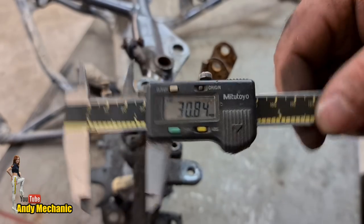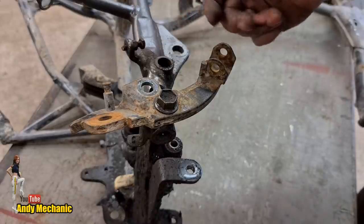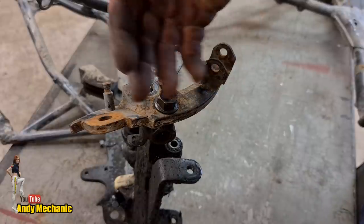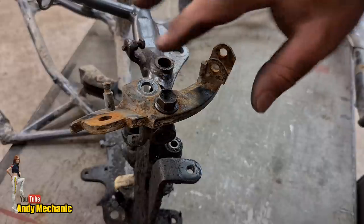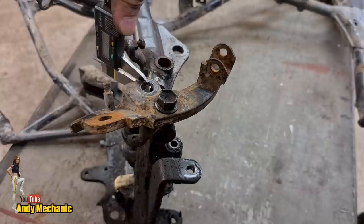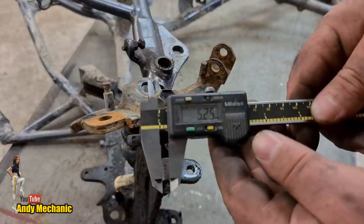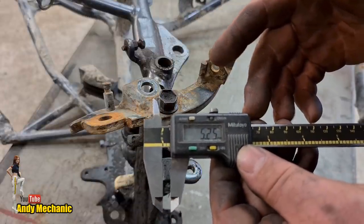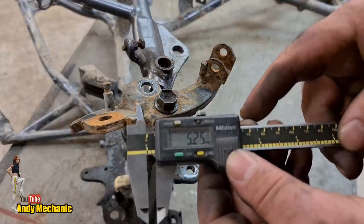Okay, now we just need to deduct the thickness of the bracket, because obviously it'll sit on the underside, and of course the tube is curved underneath, so this insert's not going to go all the way to the bottom of the tube, so there'll be a little bit more to take off from that. So the thickness of that is 5.25, so we'll say 5.5, and it was say 30 before, so 25. If we cut that tube 25 mil long, we won't be far off.